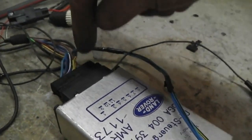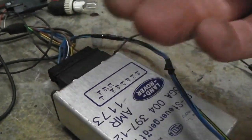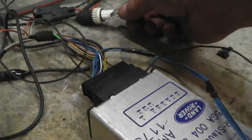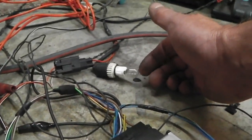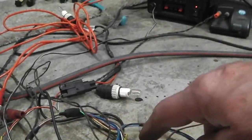So all I'm doing then is I'm going to find pin 11 on here, and the speed 5 volt pulse signal goes into there. The rest of the controls are just off on your controls, brake switch. It has to have the brake light bulbs fitted. If there's no brake light bulbs, the unit won't boot up. It needs to look at the bulbs to make the check. It must be a safety thing. So I have to connect the bulbs into here for the brake lights.